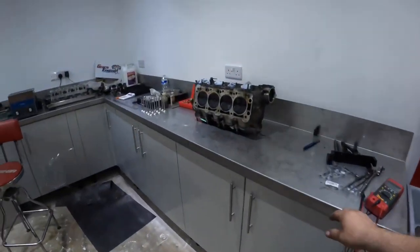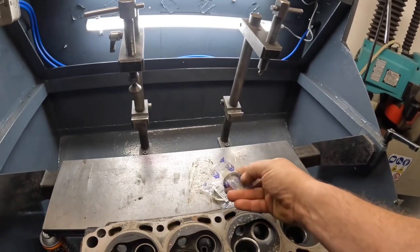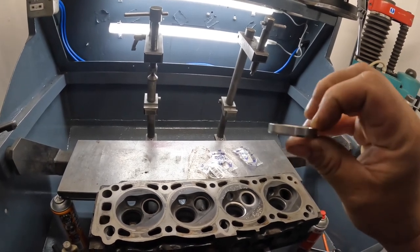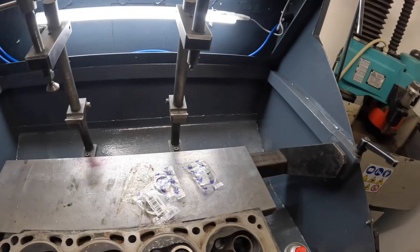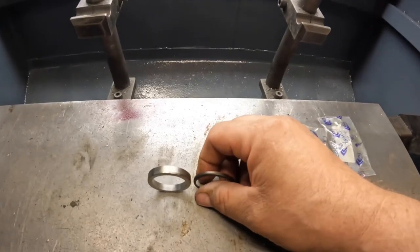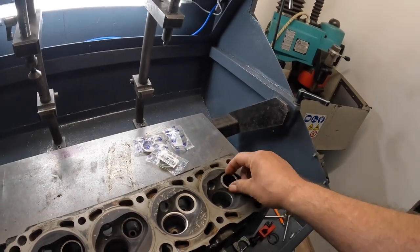The first thing I've got to do is grab a couple of seats — I've already got them out. These are just a standard style lead-free seat, it's sintered steel, like a pressed powdered steel basically. That's the depth we're going to go to — I'm going to have to trim a bit off the top once the seat's fitted so it will be just an ever slight bit smaller than that. But in comparison to what was being used, you can see the difference. I don't know why whoever fitted the old ones thought they would be good enough. I'll bore the seat out — pull the bore of the cylinder head out to take that bigger seat.